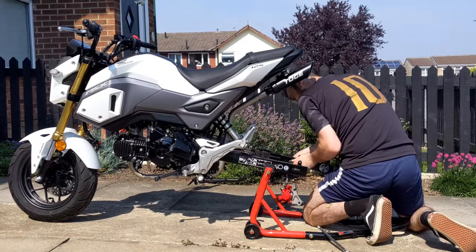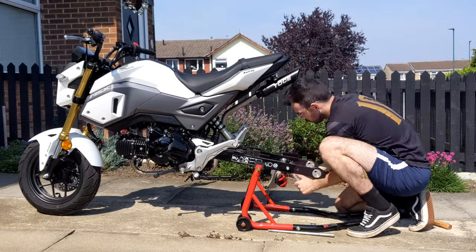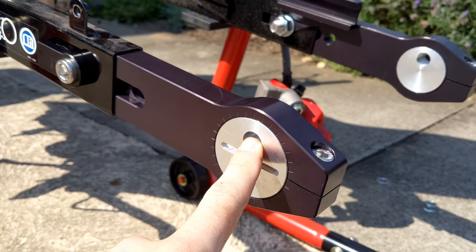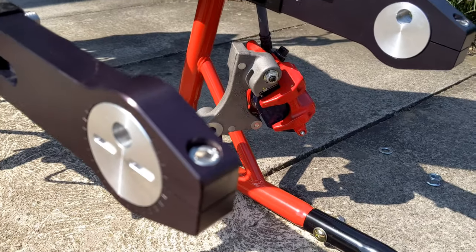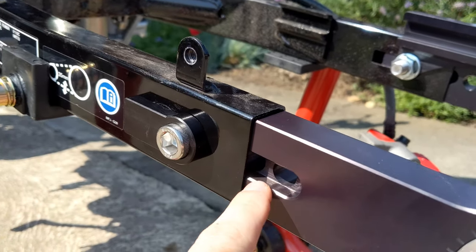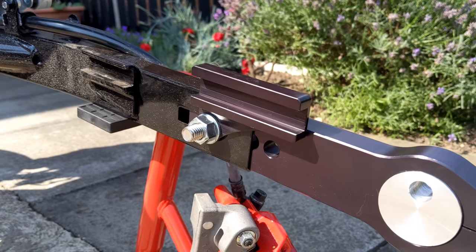Now comes the actual installation part. I was kind of expecting to have to hammer the hell out of these billet stretch links — or brackets, whatever they call them — to get them to slide into the swing arm. I even bought myself a new rubber mallet for the job, but I could have thrown them in from five meters away without slack. Here's a closer look at how it should all be set up. You want the little markers for the chain tensioner to fit in on the outside, and make sure the cap screw or allen bolt is on the top so you can get access to it nice and easy. Slide it straight into the swing arm, pull it right back, and then fit your little bolt through one of these holes — I've fit it in the furthest one.